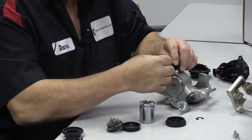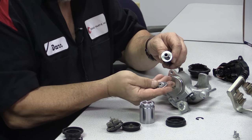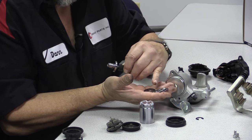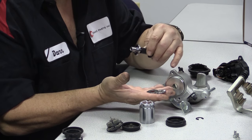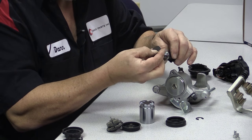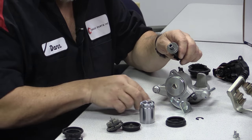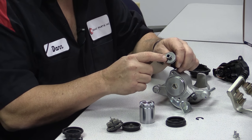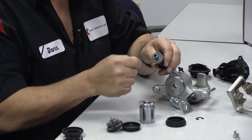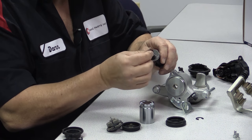As long as I've got this piece in hand, you can see it has a very small bearing set — they call it a Torrington bearing. I did not clean this up; there's a little bit of lubrication on there, but not much. These things aren't spinning all the time — they just apply and release — so you don't need a lot of grease. In fact, you don't want too much grease because it'll fling off onto the little rubber drive belt that actually turns this assembly.